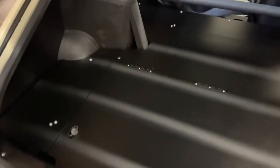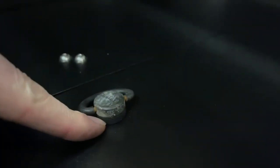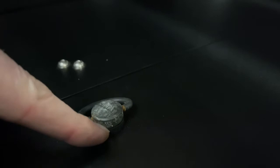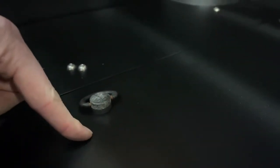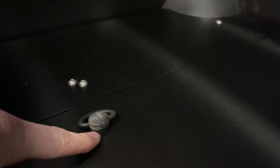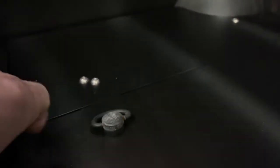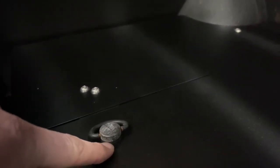One of the other things that comes with it is this rubber washer. We cut these out custom to fit on these because this is 090 aluminum — it's definitely lighter than the factory panel and more rigid, but it's thinner. Because it's thinner, the factory brackets would be loose, so we include this rubber washer to give you some nice tension and a little bit of cushion.